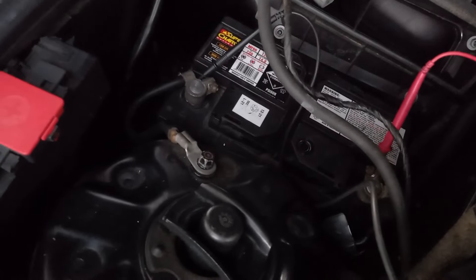I've got the van battery back on the charger and the amps are dropping pretty quickly. It's just dropping, dropping, dropping — the other battery did not go below 1.3 amps. This one is dropping nicely and should go into 1 amp, which shows this battery is in good condition. When you see the amperage dropping quickly like that it's a good sign, and it's showing 12.8 volts.